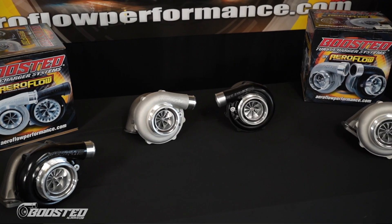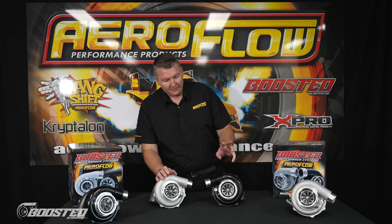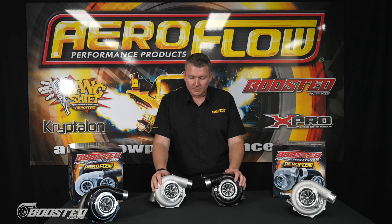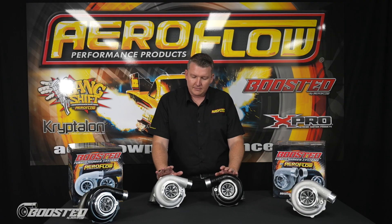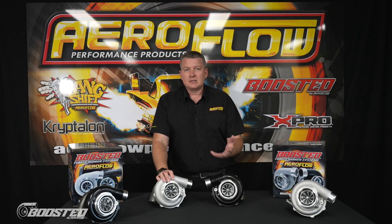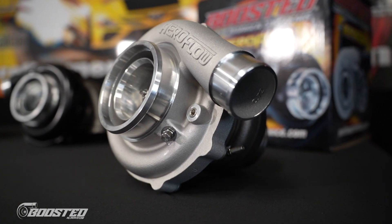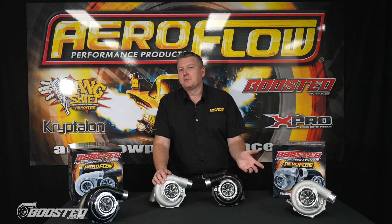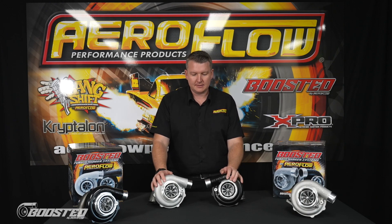So — 900 horsepower capable, small compact unit, very responsive and very flexible. We've got the V-band units available in regular rotation and reverse rotation. As you can see here, the two turbos are spinning opposite ways, and that's not just the external housing — the turbocharger itself actually spins in the opposite direction. That allows you to package a single turbo in a particular engine bay more conveniently and compactly, but also gives you an aesthetic benefit if you're building a twin turbo setup. You can have the compressor wheels pointing the same way and the turbine housings pointing the same way, making for a much nicer engine bay and allowing you to configure your pipework a lot neater.